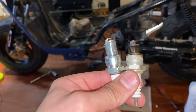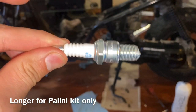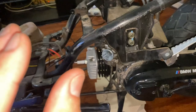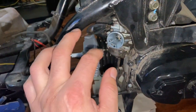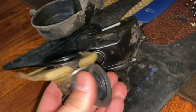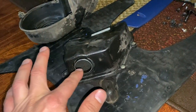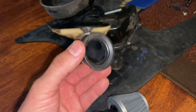We're going to put the spark plug in — this kit requires a different plug, the BR8ES, which is a little bit longer. Now I'll put everything back together and then we'll go outside and talk about breaking it in. Remember what I said about the air box — make sure when you put it back on it is 100% airtight. In our case this plastic hardened from age so we might need a new one or will have to re-silicone it. Make sure everything is good and airtight so no sand or debris gets in.